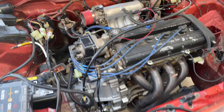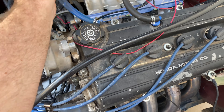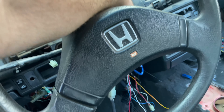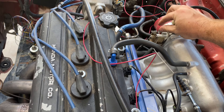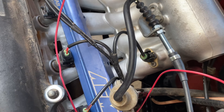It's running! But it died as soon as I gave it gas - maybe because we don't have a MAP sensor connected, or there's a vacuum leak. I'm guessing vacuum leak. But that is awesome that it just cranked and started. MAP sensor is now wired up - it should rip. And there's gas coming out - there's a big leak.